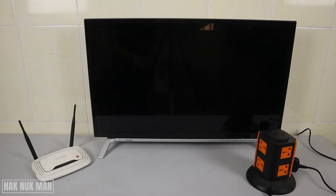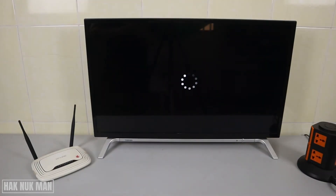Unplugging the power supply is different from turning off the TV with the remote control. After five minutes it will refresh everything inside the TV. Once you plug the power supply back in, the TV will turn on automatically. Go to the AP connection and try to find your local network.